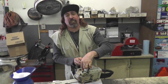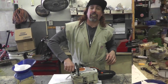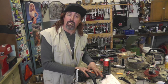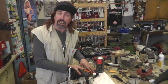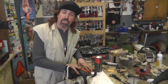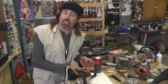You can do the same thing for the oiler too — dump it out, get all them boogers out. Put a new fuel filter on there. You should do this quite often. Another thing you need to remember with a chainsaw is you've got to keep fresh fuel in it. That's very important. Don't be afraid to run high-octane fuel — it ain't going to hurt nothing. And always use a good grade of two-cycle oil. Don't go cheap. Don't buy cheap oil because you're going to ruin your chainsaw.